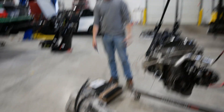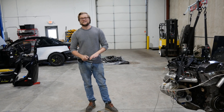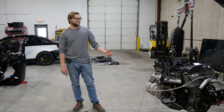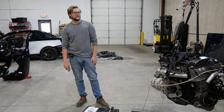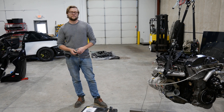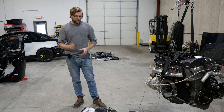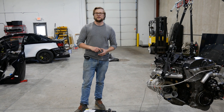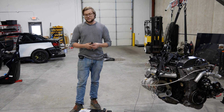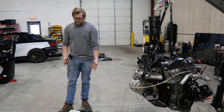So we used to have a solid hub adapter — probably what you'll see in one of our previous videos. Anyway, we used to run a solid hub on the engine, like a flywheel adapter. But we've seen a lot of clutch basket failures on race cars — four cylinders and six cylinders — with the solid hub. So we got one of the new sprung hubs that we sell from Adamat from the online store. We have a bunch in stock for all sorts of different engines like LS, 8HP transmissions, RB engines, 2JZ engines, the K series. And we have lots of different adapters, but this one's for the M50.